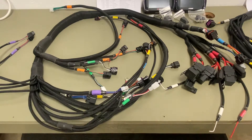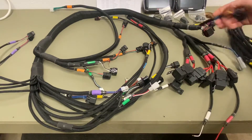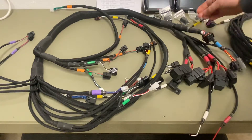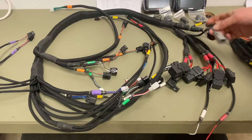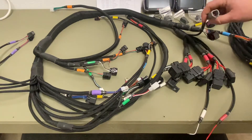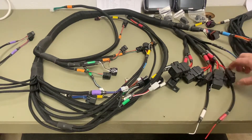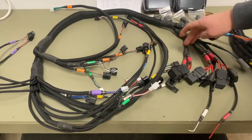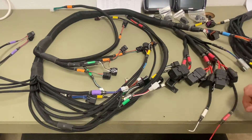We'll start off with the 450 and the 550A connector. You can see you have an ECU plug, your wideband nano plugs into CAN A, and then you have an FT550 expansion. If you use the FT550, this gets plugged into the 550 harness. You have your relays and fuel fuses up here — fuses for the injectors, main relay, and coils along with the fuse.